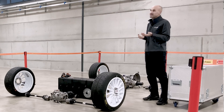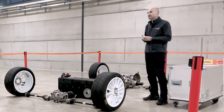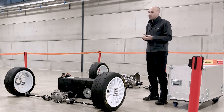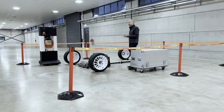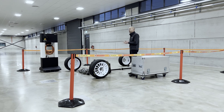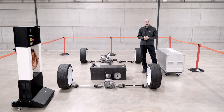Whilst you may start the stage with around 80% state of charge, it may be down at 30% when you finish. Once you've completed a stage, you do a road section to the next event, and on that road section you'll do regeneration to get the battery back up to a suitable state of charge — ready to either start the next stage or to complete a section of road mileage done purely on EV. That's one of the extra advantages: the cars have the ability to drive in pure EV mode, so if there are certain sections in a town or city, it's possible to drive the car fully emission-free for around about five kilometres.